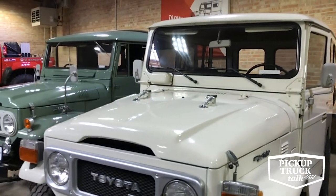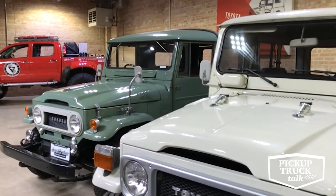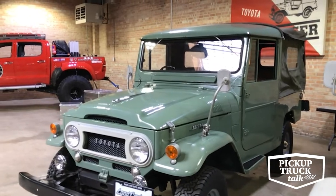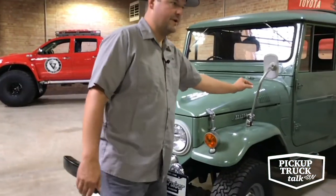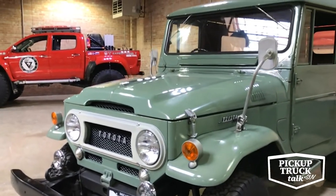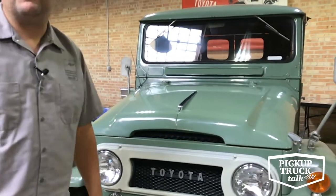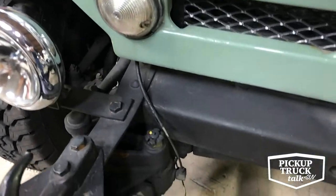The wheelbase starts getting a little longer. The BJ40, 41, and 42s are the FJ40 series — all the same wheelbase. Then you jump to the 43, and that wheelbase stretches a little bit. It's a really neat service vehicle from Japan's domestic market, with fender-mounted mirrors common on Japanese spec trucks. This one appears to have had military or forestry service — it has a central greasing system with grease lines running to all the Zerk fittings, so you could grease everything from one place in the cab. It had to have been built for heavy service.